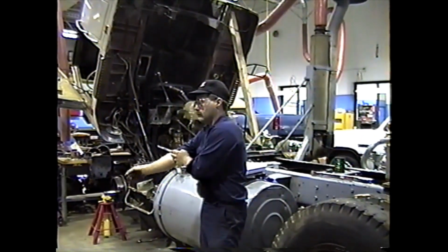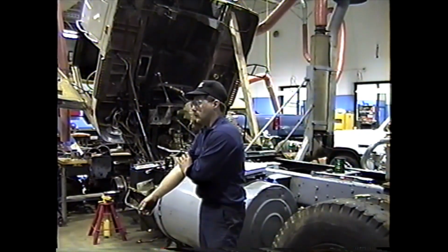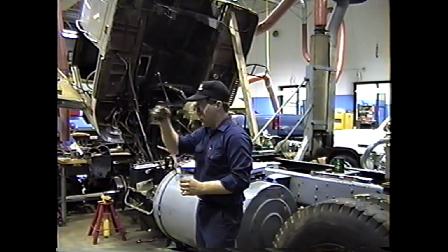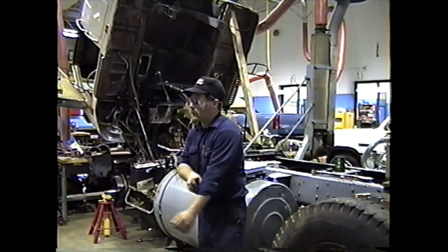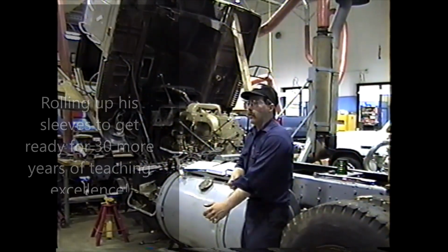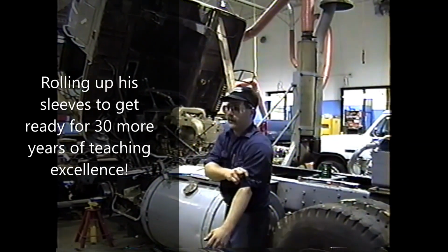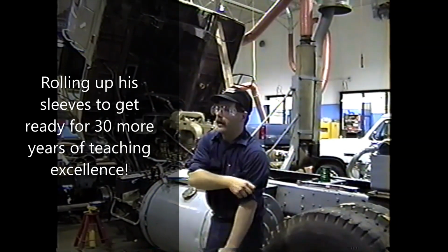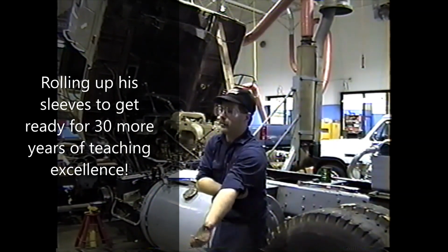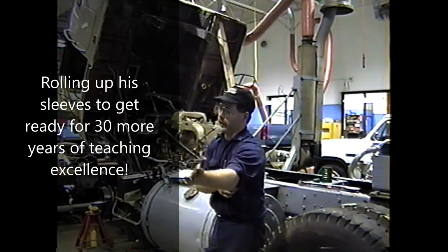You go corner, then it's the opposite one. Just keep working across the wheel, never doing two on the side of each other. Good. What was our torque spec for this particular nut? From 175 to 200. And as far as the run out goes, we did the spec, and the spec is 1/8 of an inch, no more than an 1/8.